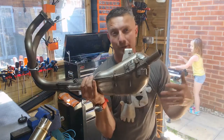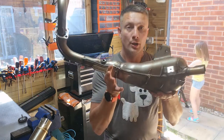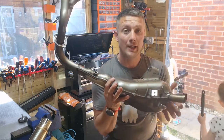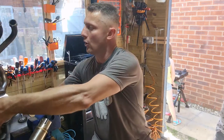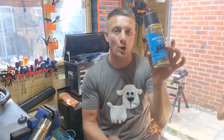The experience with that: the bike was more responsive, a little bit louder, more aggressive — more life in the engine. But since I took that one out and put another one with the catalyzer, like a stock exhaust, the bike came back to feeling like a scooter. This time I'm going even further — I welded the three holes just to see how this works. If it's still not as noisy as I want, I can always take this piece of metal out and have three holes again for more beefy noise. Before putting it on, I'll clean the whole element with degreaser and paint it matte black using high-temperature resistant paint from Amazon or eBay.